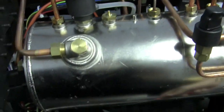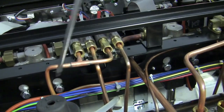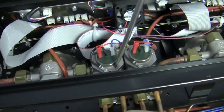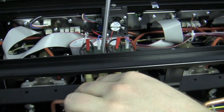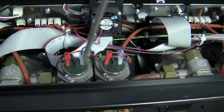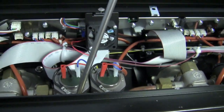The second part is that line going up into our heat exchange side — this is what's going to make espresso. It's a two-group machine so we have two flow meters. If we did not have a volumetric unit, if we had a semi-automatic unit, these would not be here — these are only for volumetric units, though the pipes would still be here. When we talk volumetric and you ask how does it know when to shut off at two ounces or 145 pulses — that is actually this. There's a little impeller inside there that's spinning 145 times, and then it shuts off. It's not saying 'I've delivered two ounces,' it's just saying 'I've rotated X amount of times — I'm done.'